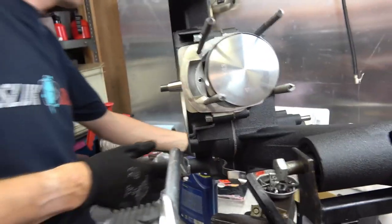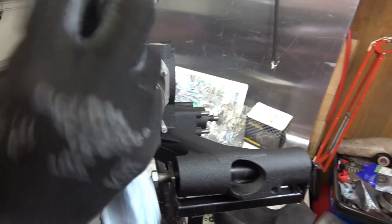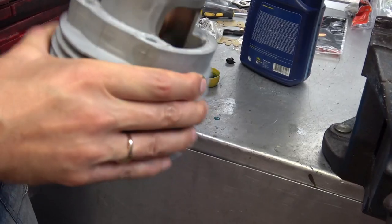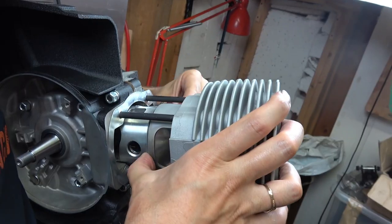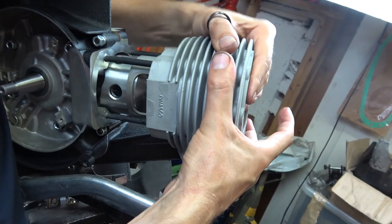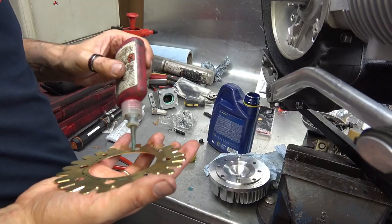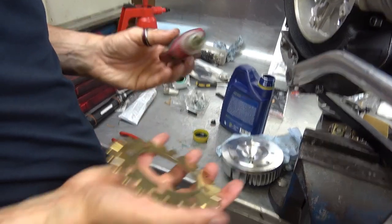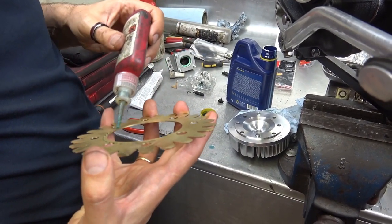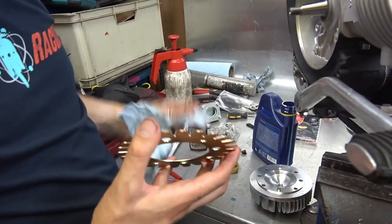I've got a bit of sealant to wipe off the piston — sealant on that side, a little bit of sealant on there. Two-stroke oil in the bore so it's got some lubrication on startup. That's the first ring in — there's a nice chamfer on the bottom of the barrel so it's not too bad. This is going to seal fine anyway because it's got eight fastenings, so it probably doesn't even need sealant, but it'll be worthwhile. Make sure there's not too much inside where it's going into the bore.